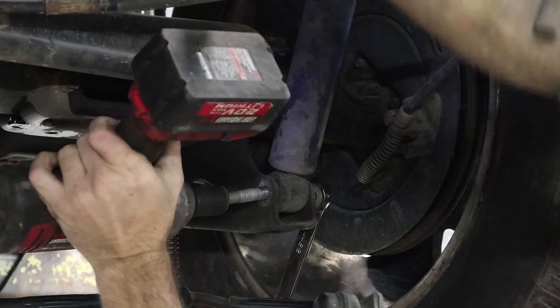One of the bolts came out nice. This one? I was making my own threads — oops, that didn't work out so well. So we'll fix it. Those bolts are just splined in there — you knock them out, kind of like wheel studs. Bolt our good one back up, slide another bolt in there, put a nut on it. Done. Crisis averted.